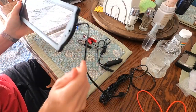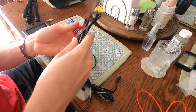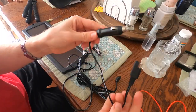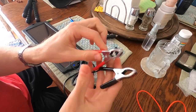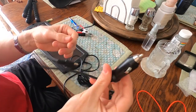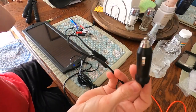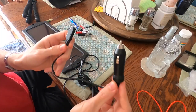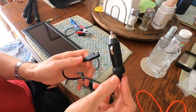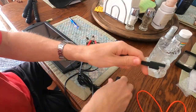Alright, let's get to this one. Here is the panel — it comes with a cord with a quick connect attachment, and then you've got two attachments: one cigarette lighter adapter with the connector, and then alligator clips to clamp directly to your battery. The problem with the cigarette lighter is most cars don't have power going to it when the car is off, so you'll probably have to wire it up onto a switch to leave it on when you have this plugged in.